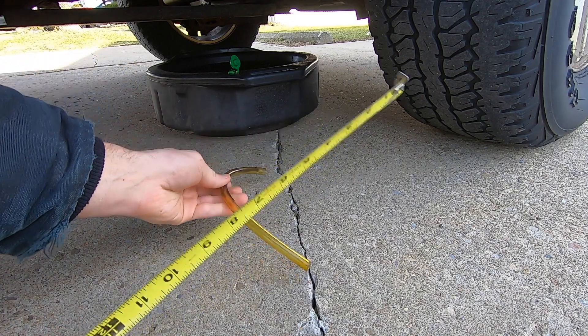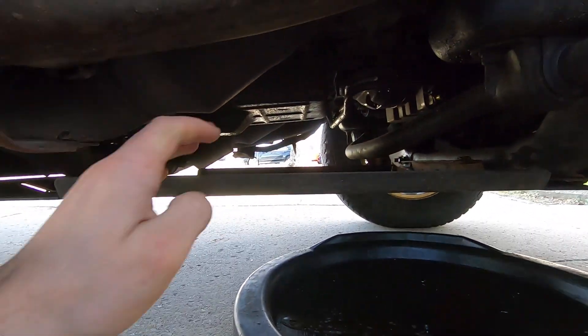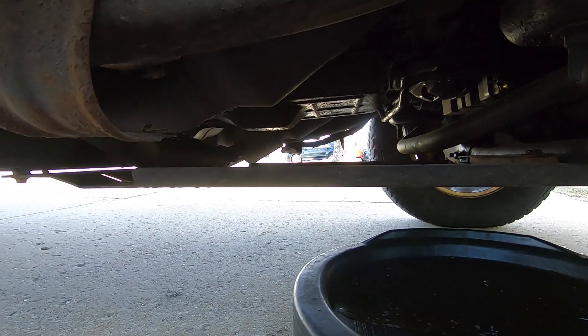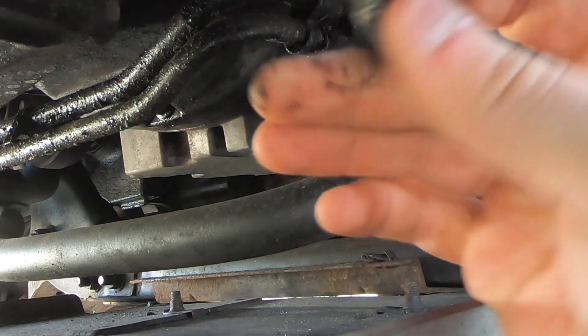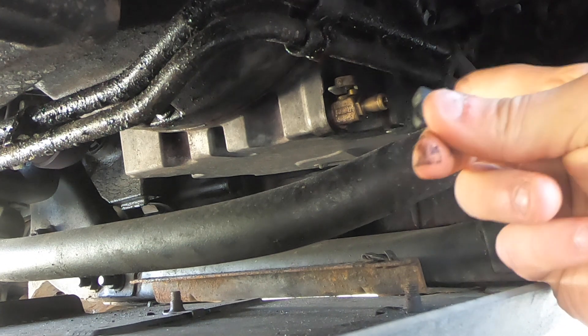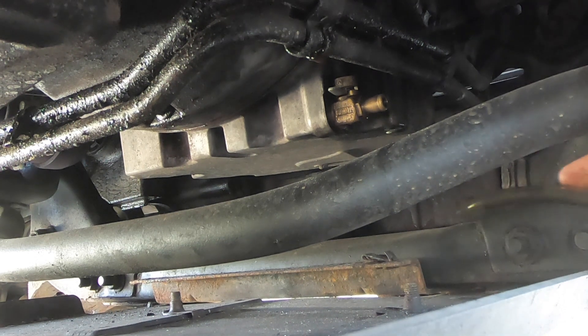You probably won't need a foot-long hose, or might not need a hose at all, but I have these aftermarket skid plates that I put on there because my truck didn't have any. I don't really do much off-roading, but I just wanted something on there in case I bottomed out. I opted to get this clip fork that goes on the ring just so it can't turn. I've had this valve on there for about a year with no leakage issues whatsoever. It's pretty fail-safe — it's just a ball valve with a spring, no O-rings that can fail and leak. I got this hose so I can make it past my skid plates.